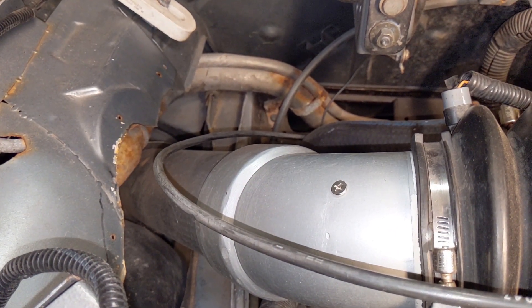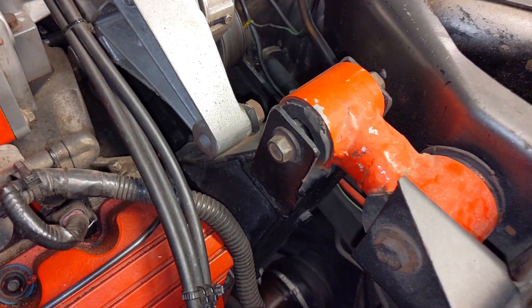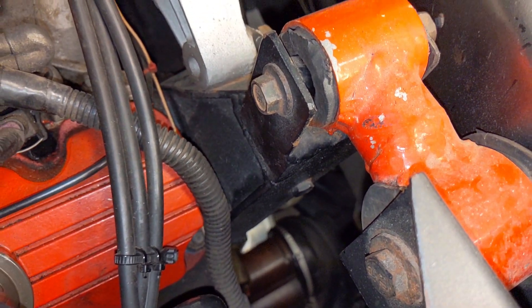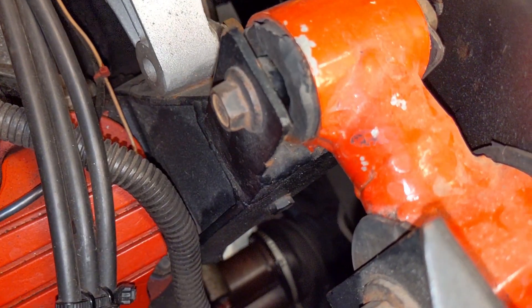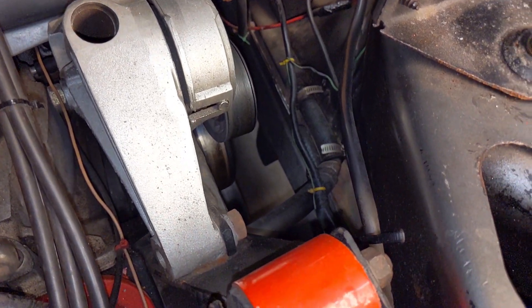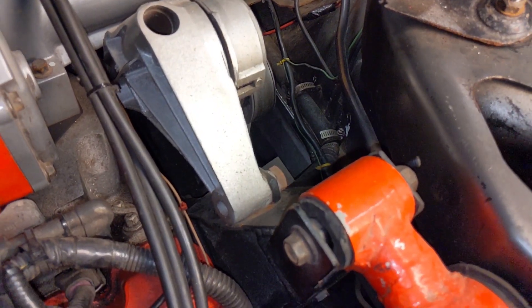PVC versus steel or aluminum actually provides a little bit of insulation — the engine bay probably gets up to 120 or 130 degrees or more, so this kind of insulates the two different temperatures of air. Next let's take a look at the dog bone mount and how it attaches to the engine. There really wasn't a blueprint, and I found this to be a challenging part of the build. I used scrap metal to fabricate this mount and how it bolts to the head, and it's also tied into the tensioner for the main belt drive, which is a recycled tensioner from the original engine.